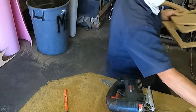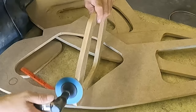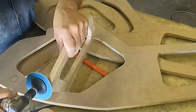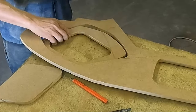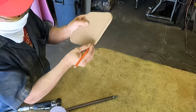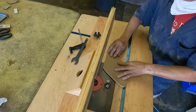For example, I will use vinyl in there so I have to cut a little bit. If you have a router, it is better to use the router — you will see me using it later. If you don't have it, just sand it to whatever the material thickness is. I got that piece and put it in — you can see it is a little loose. It should be loose; when you wrap it with vinyl it will be tight. On this one I will cut a quarter of an inch — because that will be the shape of the metal mesh on top of the speaker. I am using the router — it is perfect for this.